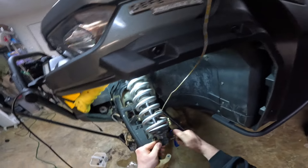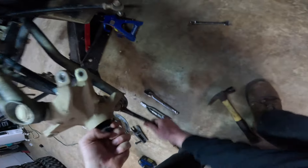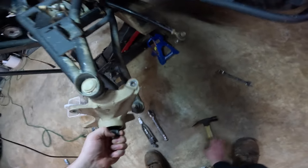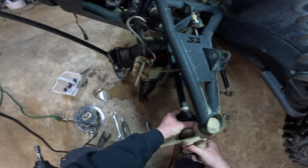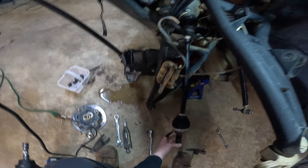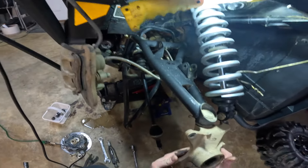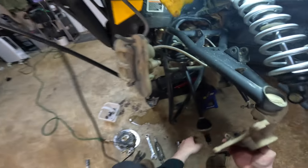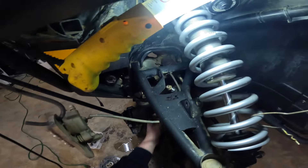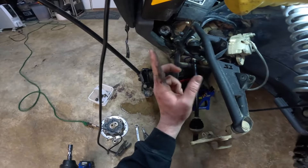It's just easier to remember — put them right back where they go. So now with that up, I gotta try and get that off, probably grab a hammer. There it is. Now at this point I might be able to finagle this — there it goes. So there's that axle. We can probably hang this up — we don't even have to undo this one, so if you don't have to, don't worry about it. I gotta loosen the other one before we get weird with this thing. Let's go to the same spot on the other side so we can get the sway bar turned out of the way to pull these axles out.